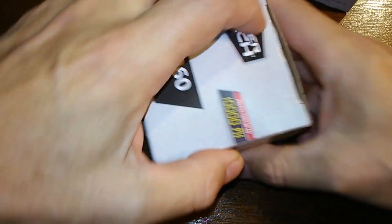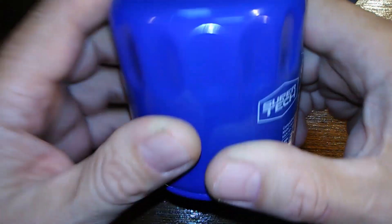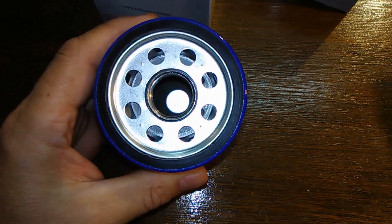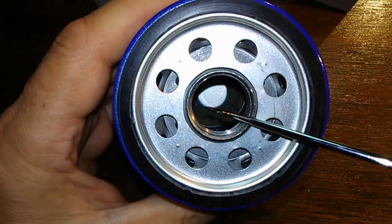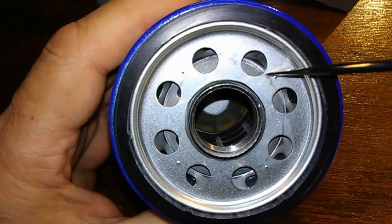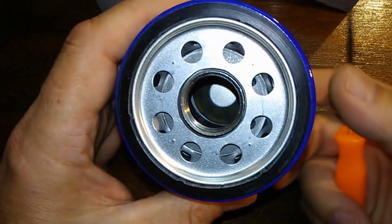Let's start with the ST-160. I want to show you two distinct features on these oil filters that you can check out before you even buy them. One has metal end caps and the other one has felt end caps. How you can tell is if you look down this hole — this one here doesn't have a bypass valve down there. Also, if you check these holes, it's got metal in them. You can hear it. This one has felt end caps.